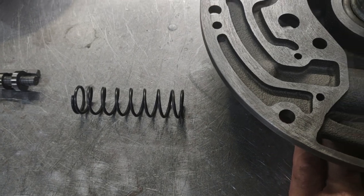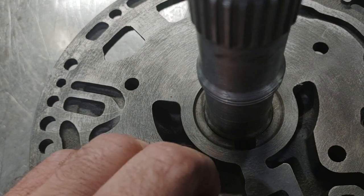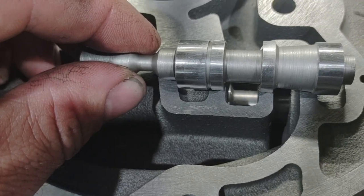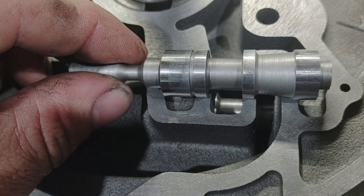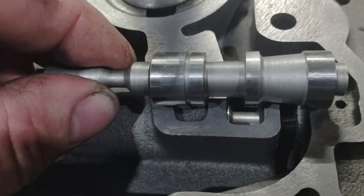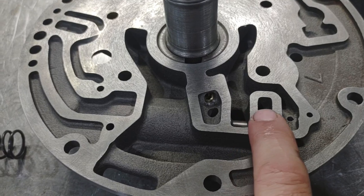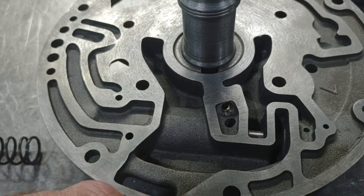It's static — it's not a variable pressure, it's a static pressure design. Anytime this valve is in that position your pressure is going to just run away. This is not the operating position — this is when the vehicle is not running and the pump is not producing pressure. It has to move to at least about here to begin to regulate. What that does is it takes pressure from the high pressure side and allows it to bleed back over into this circuit, which is the suction side, to go back into the pump and recirculate.